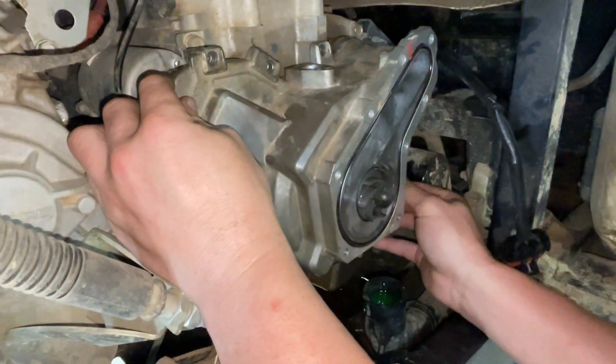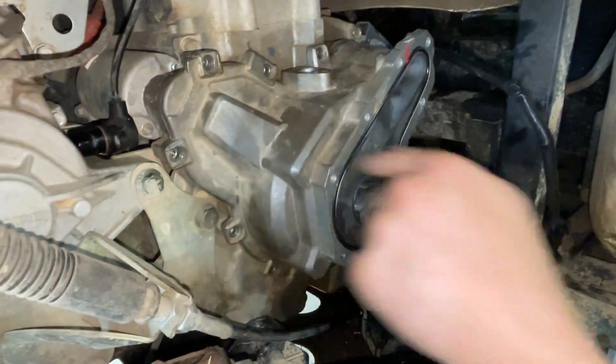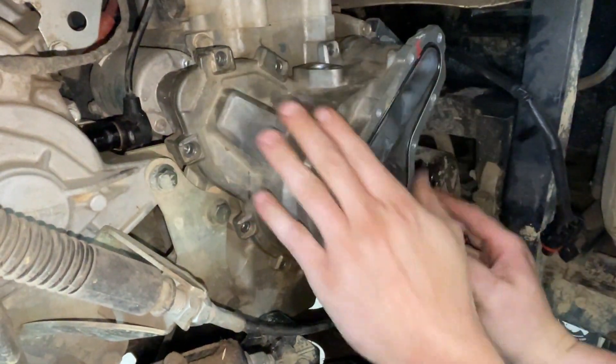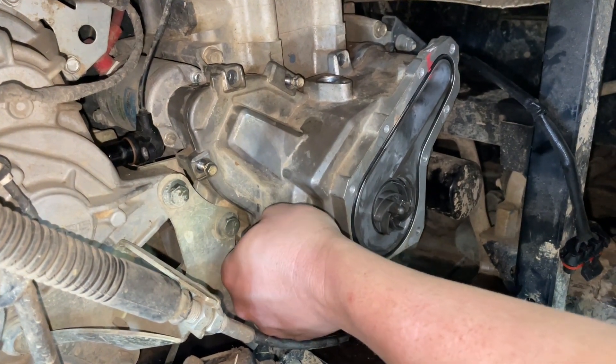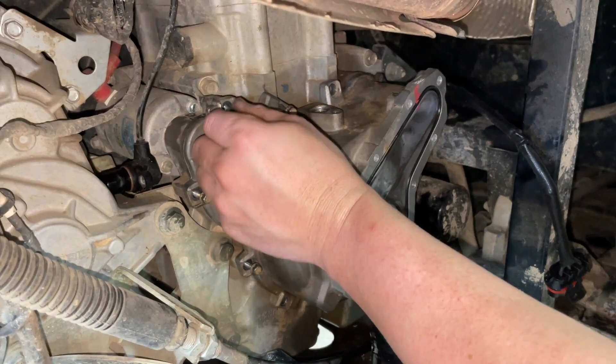It's down on our case flush. Now we're going to put our outer bolts in — we want to do them in a crisscross pattern to make sure this goes down flush. Just in case anybody is wondering, the torque spec on these is six to seven foot pounds.